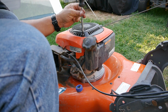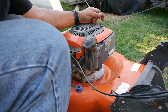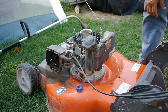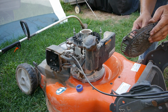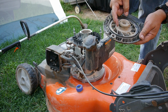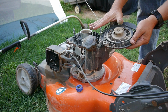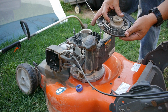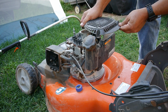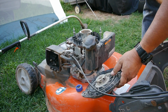This thing, I'm going to have to ask him what the hell he has been doing, because this thing is physically mangled. Nothing seems warped, and everything's turning fine until we put this on. So let me clean this thing up, and I think that little tab is bent, so when you're pulling on it, it's also pushing it up, you know what I mean? See the way it's bent in this way? So when I'm pulling it, it's trying to push it up as well as going around. Let me clean it up and see if we can bend that back into shape.